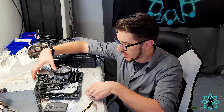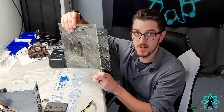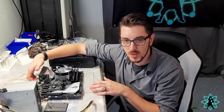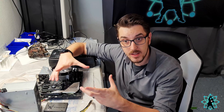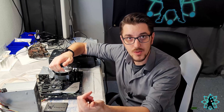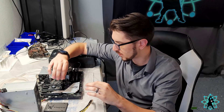For the motherboard, I went ahead and cut a piece of acrylic and bolted the motherboard onto that, so it'll actually be able to stand up inside the tank. I've also cut some pieces of acrylic to mount the radiator inside the lid and pulled all of the old lighting out because I won't need that. I did, however, install some lighting under the ridge of the tank so you'll be able to get some cool effects.